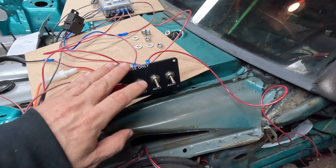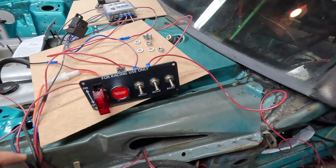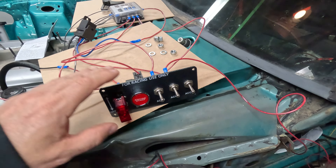What I was telling you the other day I was going to do with that switch panel I bought from the swap meet — I'll turn around here and show you what I've been up to. Wired up the main here, everything's got fusible links, got a relay for the main that activates everything. You turn that off, it cuts the power to the relay and cuts the power to the auxiliary. We have engine start, ignition, and fuel pump.